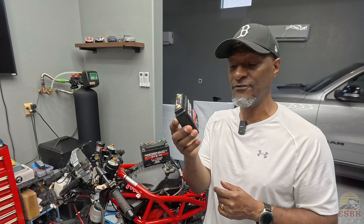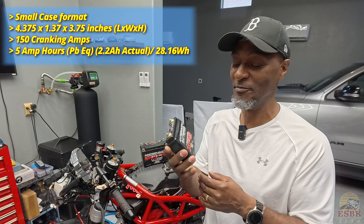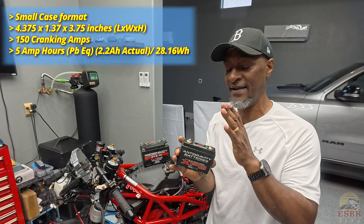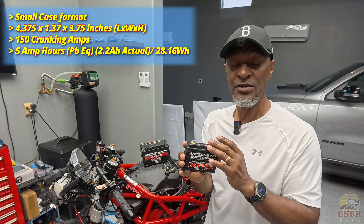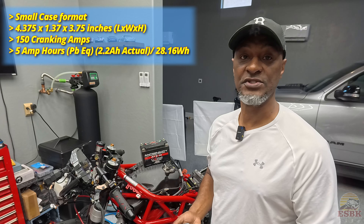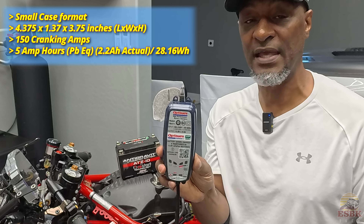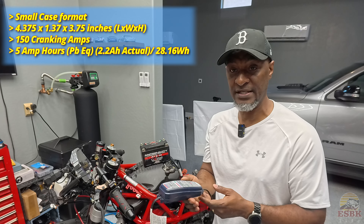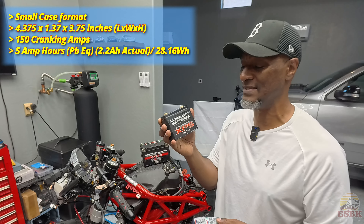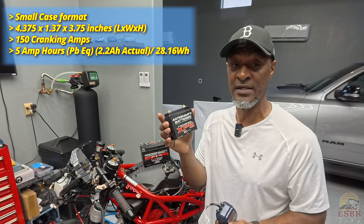I'll put the specs up on the screen for the SC1 right now so you guys can see exactly what I'm talking about. This is a four-cell 12-volt battery, and it's marketed as a race spec battery because it doesn't have any battery management system — no BMS at all. So you can overcharge and you can over-drain this battery if you don't know what you're doing. As a result, you'll want to make sure that you get a proper battery charger, like this Optimate here. This is specifically made for charging lithium batteries and has protection so that once the battery is fully charged, it stops and won't overcharge. Then it will just maintain it. Anti-Gravity also says this battery can sit in a corner without any parasitic draw on it for several years before it loses any charge.